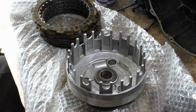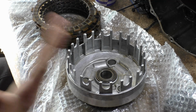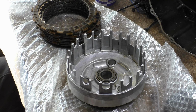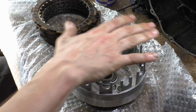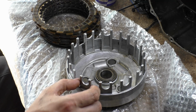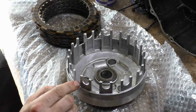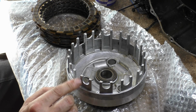The whole point of this is just not to go mad and say, I'll keep on going until it disappears. Because with these big coarse files, you're probably taking 50 microns more, 100 microns more than you should have done. And that means that there is more chance. Now, how much can you do this? I would only recommend shaving these off depending how big the grooves are. So it's a good idea to try and measure the groove thickness.